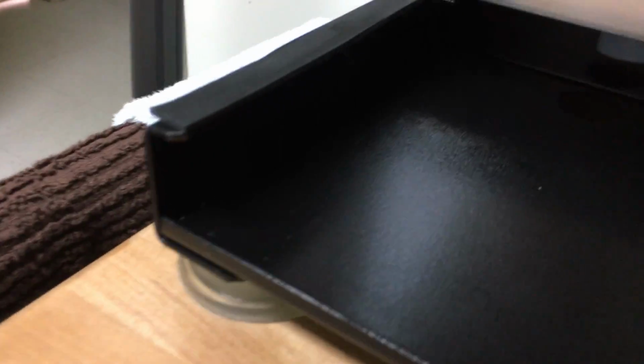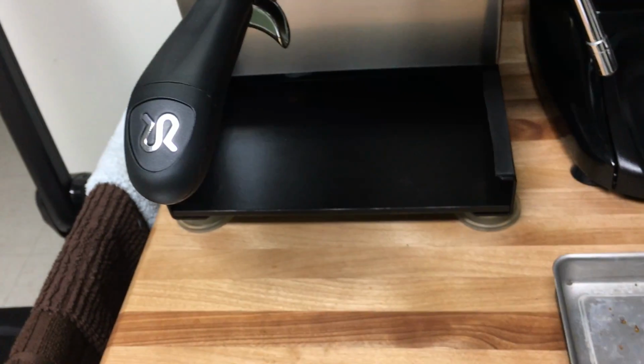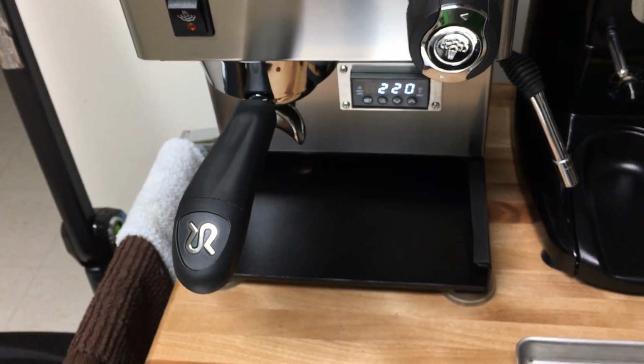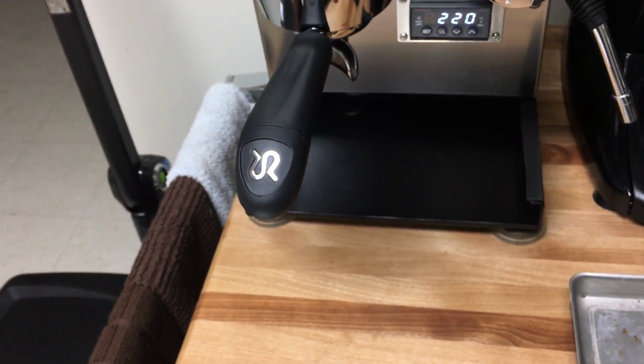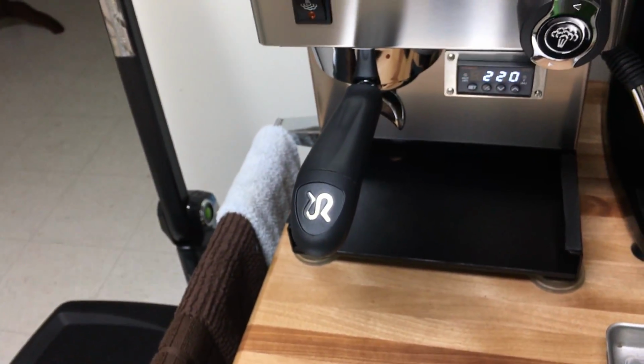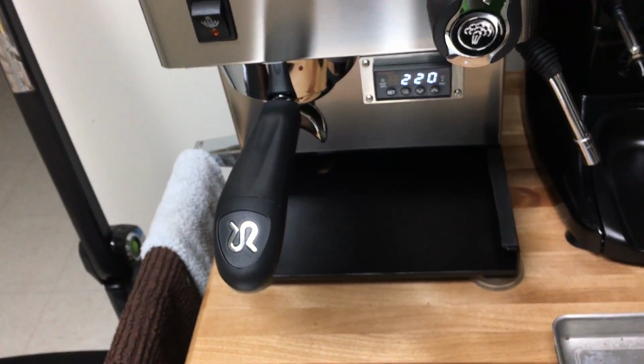Okay, so I sprayed WD-40 here in this seam here, all over in here, and over there, pretty much all over. I sprayed WD-40 anywhere where water can get in touch. And if you're going to use WD-40, just make sure you don't wipe it. So you spray it all over and just let it sit. Do not wipe it for best rust protection. You don't want to wipe it. It even says so on the actual bottle, on the actual can.